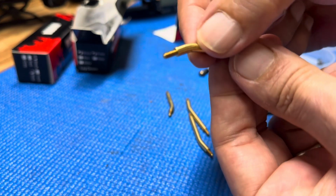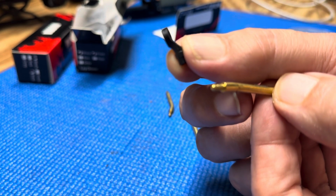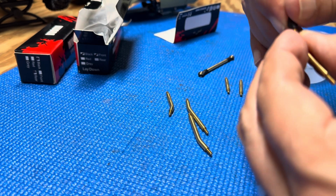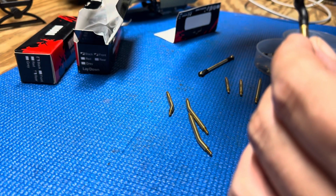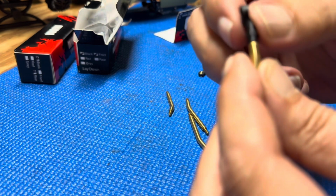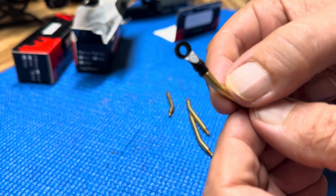On the front, high clearance links, on the front of the link, I'm using these little angled ball ends that they come with. I use those on my IR40, and with the aluminum axles, they go in and match up and mount on the axles really well. And I forget the direction they go. Let's see. Yeah, the left-hand side would go just like that. So that'll be on the front, and the rest of all the links just use the standard ball ends.